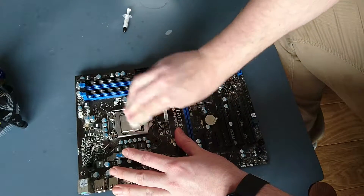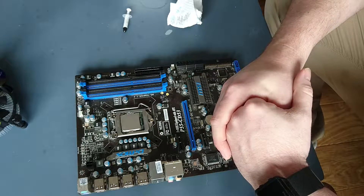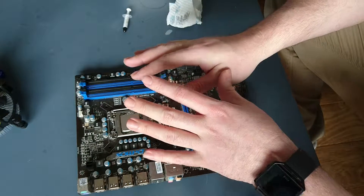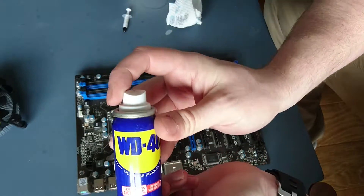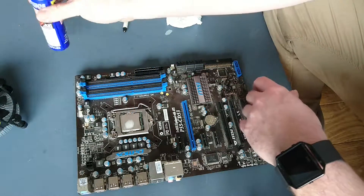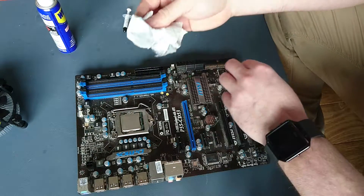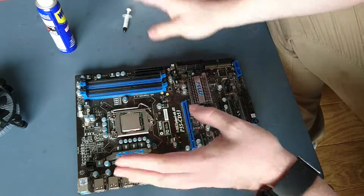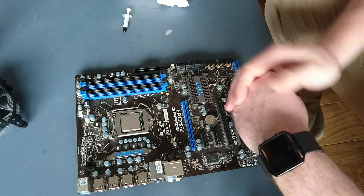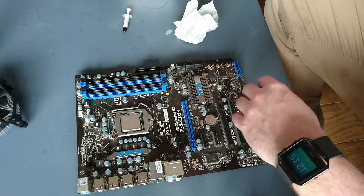There's some thermal paste on the CPU from the bottom of the cooler. This is fresh so it's easy to wipe off, but if it's been used for a year or more it can be hard and caked on. When reconditioning graphics cards I always redo the thermal paste because it goes rock-solid. One thing I use is WD-40 — it's non-conductive and will quickly wipe away whatever's on the CPU. That said, use it very sparingly — just a couple of drops — and if you spill a lot, let it dry out completely before doing anything.